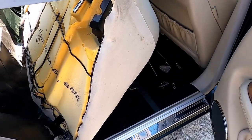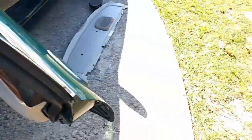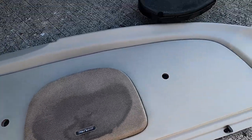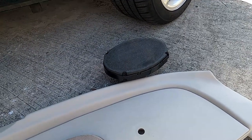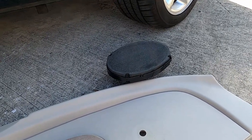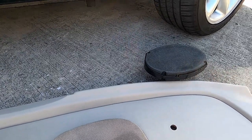Next up I'm going to run to the auto parts store and see if I can pick up the tan spray paint — ideally something for interior use — to try and match the color on this speaker grill. But first I'm going to test out this speaker and see if our repair was successful. I'm going to get that connected back up, dropped in place, and screwed back in, and if that works we'll continue on to the rest of the reassembly.